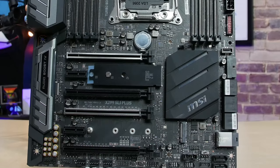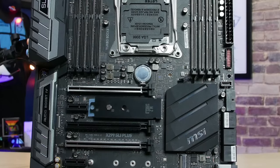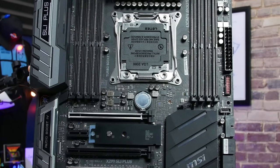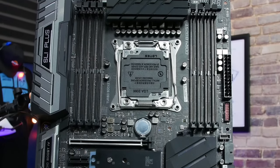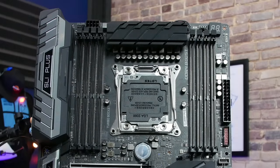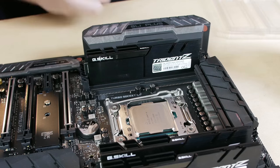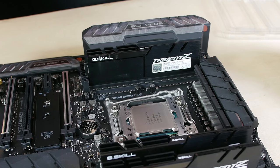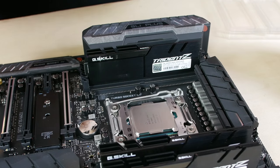The parts selected for this build include an MSI X299 SLI+, a great Socket 2066 motherboard that's middle-of-the-road in terms of features and value — not crazy expensive, but a pretty decent motherboard for X299, especially for the 8 or 10-core CPU. I've also selected G.Skill Trident Z RGB memory. The specific kit is linked in the description — it's DDR4-3600, a kit of four, so we're going to be using quad-channel, as was meant to be the case with X299.